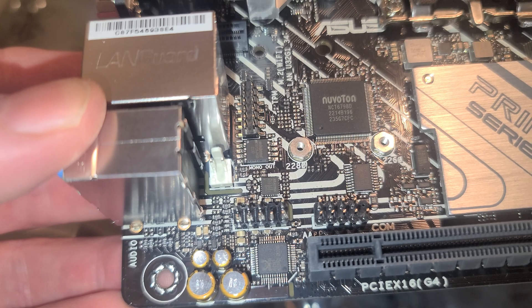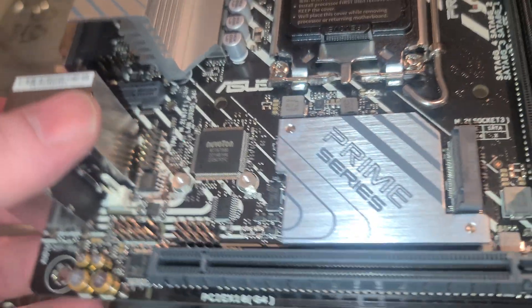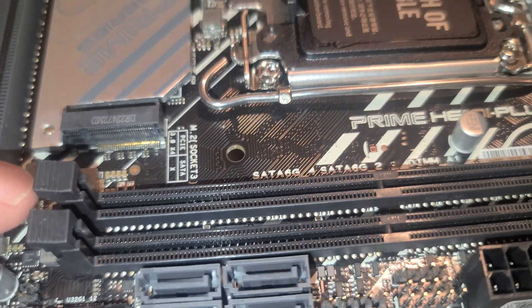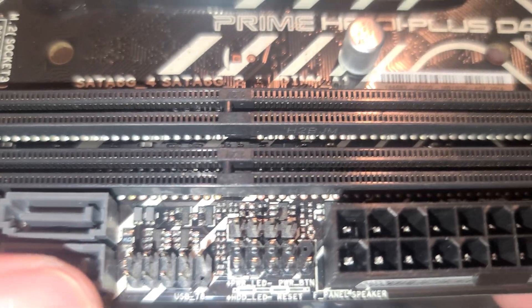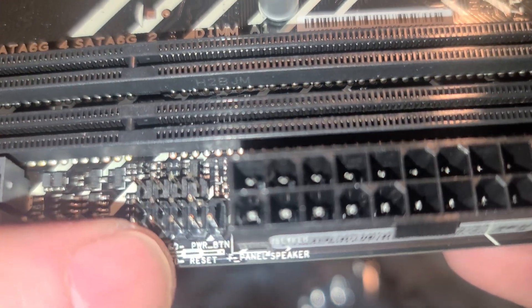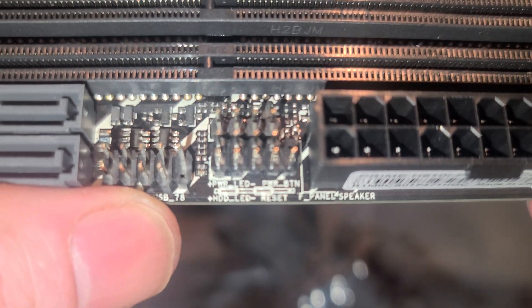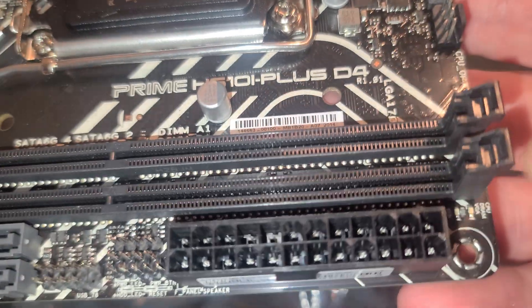Let's see if we can see what's what. One of these is HD audio, probably this one, and this one's probably USB 2.0. And if we come over here — this guy's USB 2.0 right here. Now these should be your front panel connectors right here. If we zoom in further — yeah, there you go — you can see what the connectors are. 24-pin power connector there.